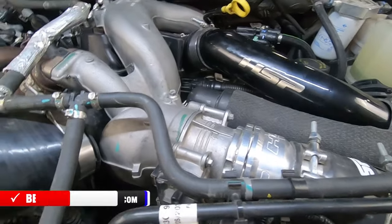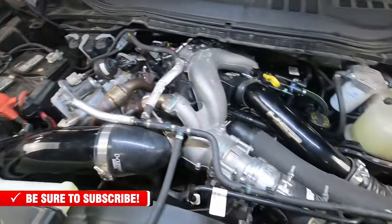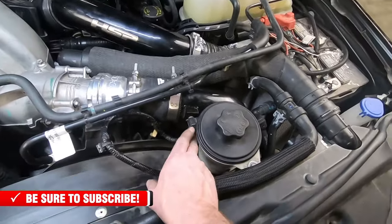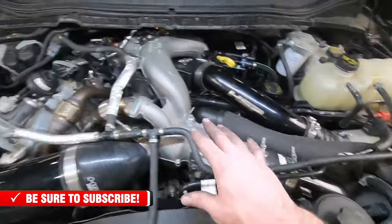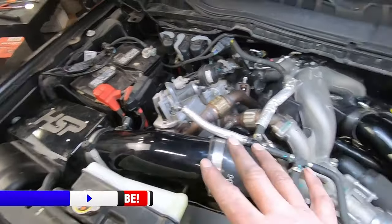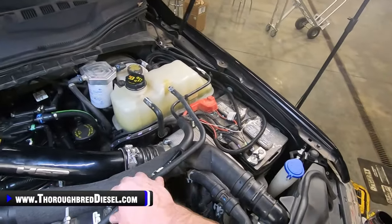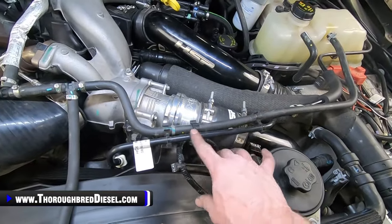All right, let's go over finishing touches real quick. So we've got our intake system on our aftermarket piping, like I was talking to you about. Don't forget to hook up your air temp sensor right here and then get that traced correctly. We took our coolant line, which was laying underneath of our intake, we brought it over here, hooked back to our degas bottle, routed it correctly, put our vacuum line on, the little short piece, it is in, we got it routed correctly.